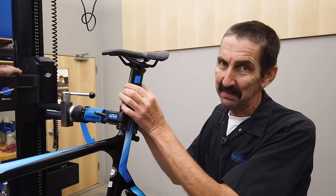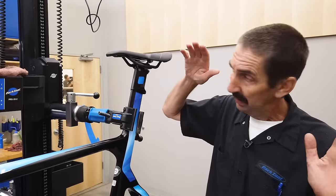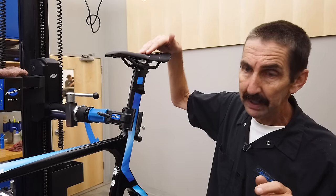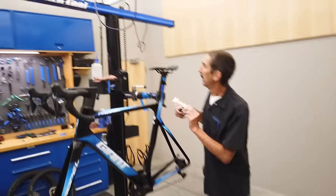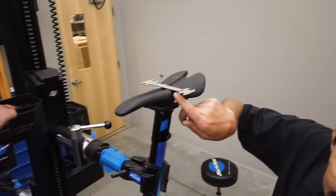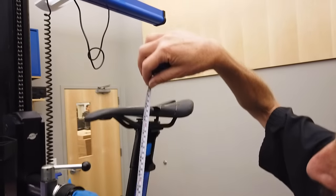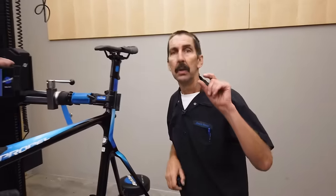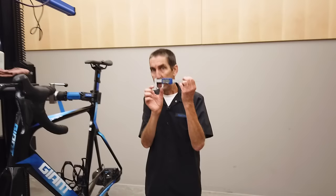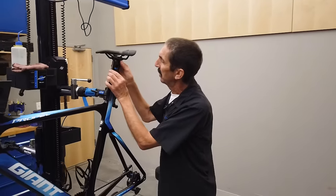So this is a brand new bike and we need to shorten it. Our friend wants 81 centimeters from 84 centimeters — so we have 84 centimeters here and we're going to come down to 81. I like to use a straight edge across the top — that creates a nice definite line. We get a nice little slot — how convenient. So here we come up: 84 centimeters, pretty spot-on. His other bike measured the same way was 81, so we know it's going to be 30 millimeters shorter. Let's pull this off and see how this works.